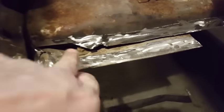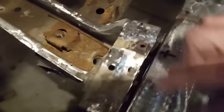I went ahead, because you won't be able to pull this piece out. I had the scribe line here and I cut it right along the scribe line, and I cut the piece out of the way of the cross member, there and there, up here in the corner. You can barely see it there with no light. Right here where the panel ends, and then I cut it off. That way, because the scribe line I put in is along there, I don't have to worry about removing that piece, and it should lay flat there, and I can remove this piece after I cut it. Back here too, I just cut away the corner here. That's all I did. And of course then I repaired that there, seat belting.